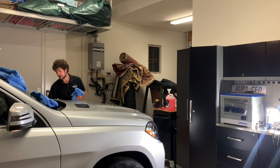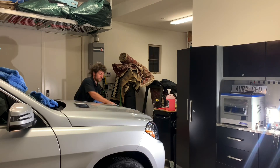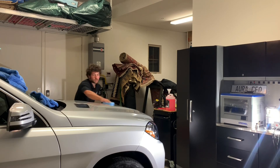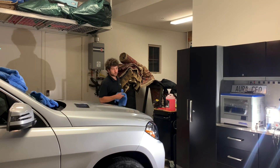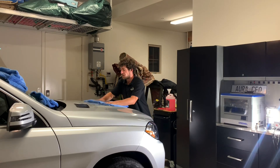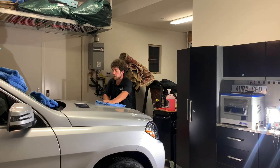After you've applied Ceramic Light, it does have a cure time. I always tell people to wait at least two weeks before getting it wet and washing it, so the coating has time to harden. You can stick it outside in the sun to help speed up that process — it's more of a chemical reaction, but sunlight can help bring out gloss. It's basically like IR curing the car. At my shop we used IR cure lamps after coating to bake it, which would increase hardness, longevity, and gloss.